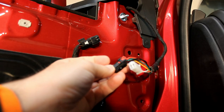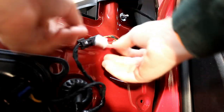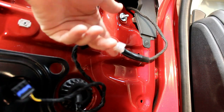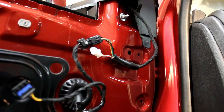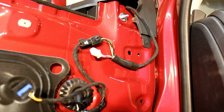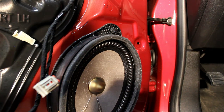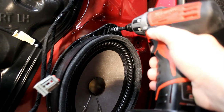Next, I'm going to go ahead and plug in this connector for the mirror. Make sure you close the locking tab. This other white connector is for the auxiliary features that you have on your Boost Auto mirrors, which they provide a wiring harness for as I showed you before. To get access to inside of the door panel, which we're going to need in a minute, we need to remove the speaker, which is just held on with one 7mm bolt.